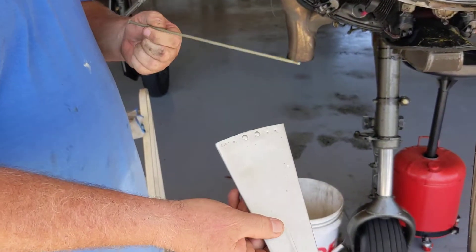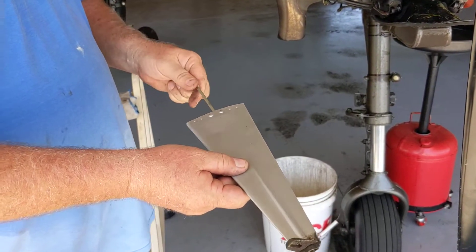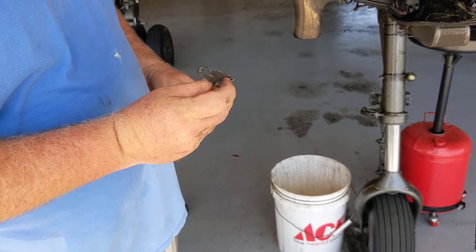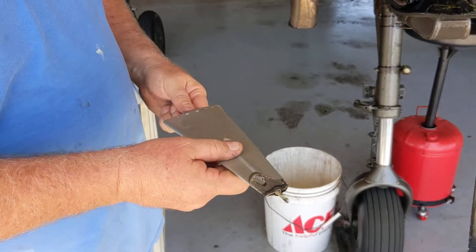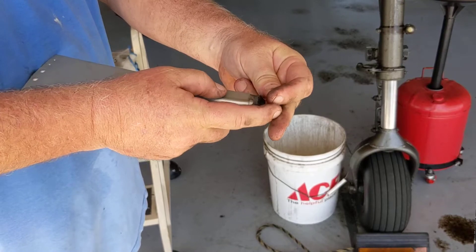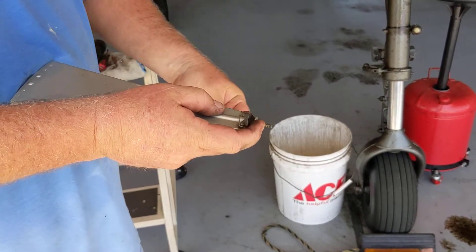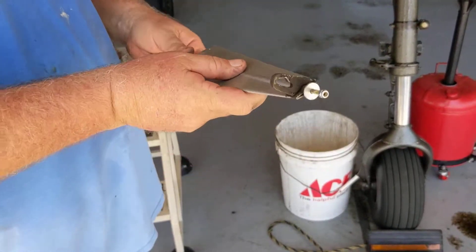I have the existing gill and a new rod that goes through. Some of them I found have been tough to push all the way through, so I have bored this hole out to make it easier to slide through. Then I put a new stainless flat washer on the other side, rather than the jam nuts, and a new seven millimeter stainless self-locking nut.